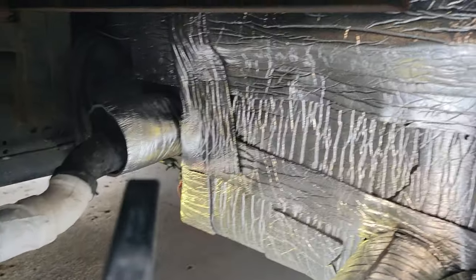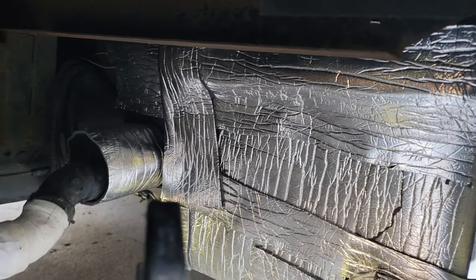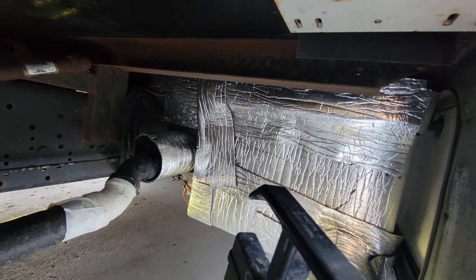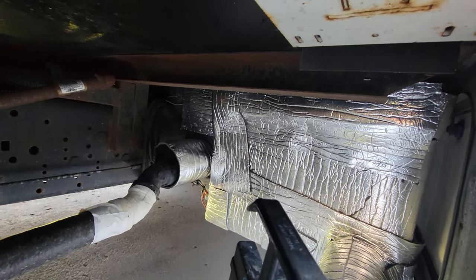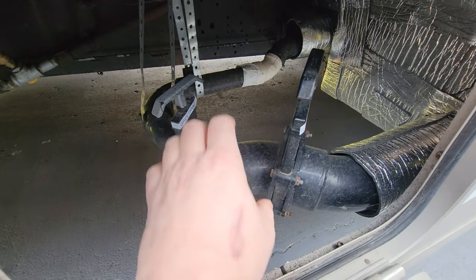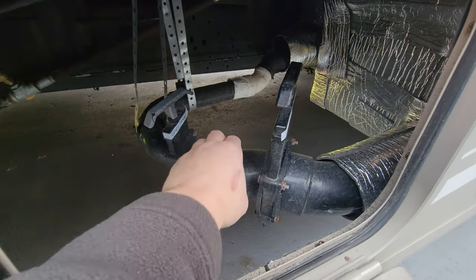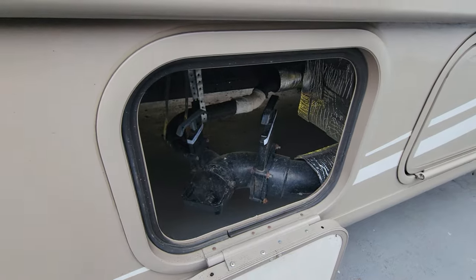The Vegas comes with so-called heated tanks, but it's just two tiny heating pads exposed to the outside. I bought self-adhesive thermal insulation and wrapped both the black and gray tanks as much as possible, and added two extra heating pads. I'm also planning to add 12-volt elbow heaters from Amazon at the corners in the spring, and wrap those elbows with insulation and one heating pad each.